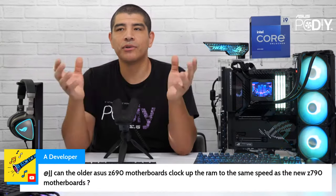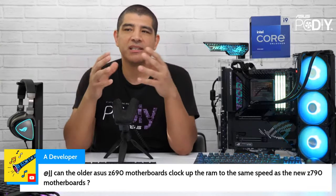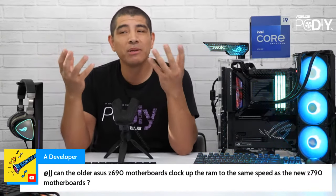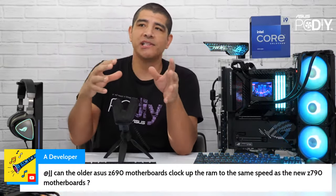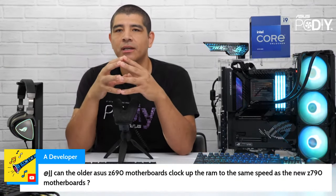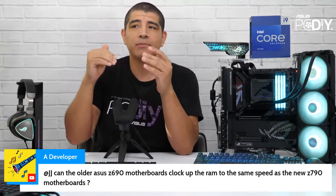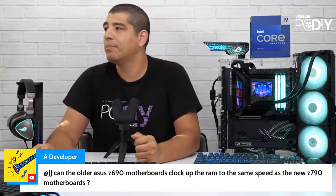Within 4DIMM configuration, of course, that is more influenced by rank, density, IC, and the IMC quality. And so there you were nominally seeing probably closer to about 4800 to about 5200. Some better CPUs were seeing maybe about 5600, and really great CPUs maybe getting close to about 5800, maybe 6000. You will be able to see scaling improvements on Z690 with a 13th Gen series processor. But as I noted, there's been a little bit of optimization in some of the topology and the overall design of the motherboards to help extend margin a little bit more. So overall, I'd say marginally, you will see better DRAM scaling on Z790 based motherboards than you saw on Z690 series motherboards, but you would still be able to see a benefit, okay?